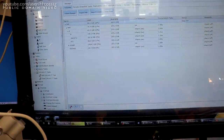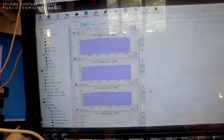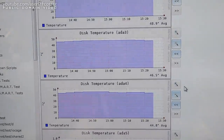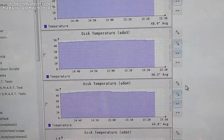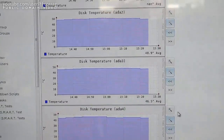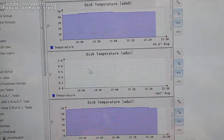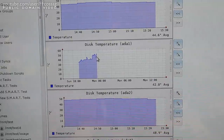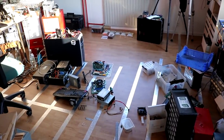I've installed FreeNAS and gotten used to the basics. Looking at the disk temperature reporting, all disks are high but manageable — these are all very old 7200 RPM drives, so they use more power at idle than my real disks will under full load. The temperature sensor on the oldest drive appears to have broken: it was running about 7°C hotter than the others, then got over 50°C and just stopped reporting temperatures. I'm wearing a Dell shirt. Why are computers so difficult?